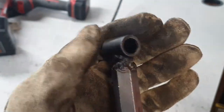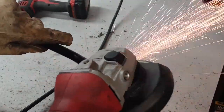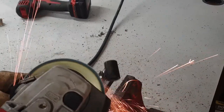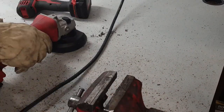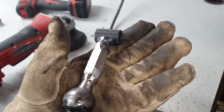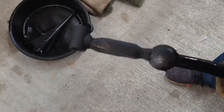I'll go ahead and grind it down a little bit just to smooth this up some. You want to make sure that down here, where the plastic retainer goes, it's nice and smooth — take off some of those little weld BBs and all that. There we have it — one modified short throw shifter. We'll go ahead and hit it with a little black paint, clean it up a little bit, make sure it doesn't rust, and sit it down there in the car.